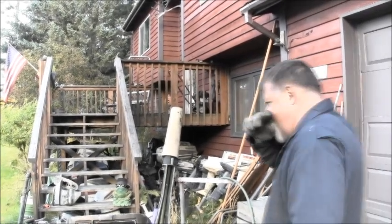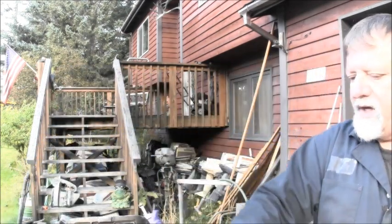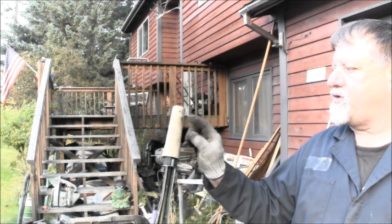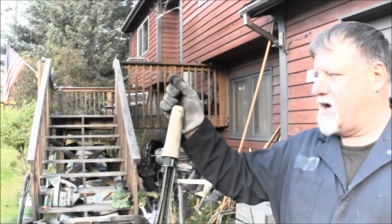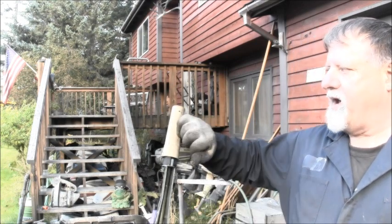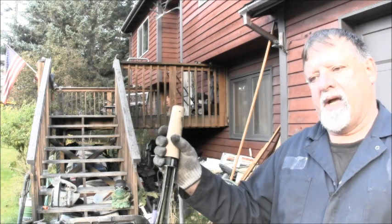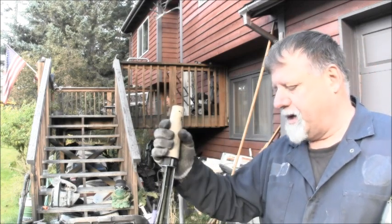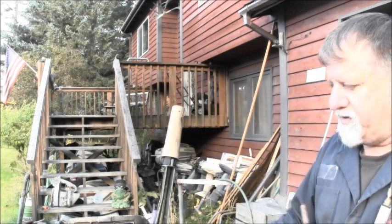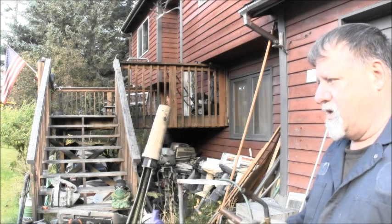Okay, here's your hack. You see this Phillips screw here? All this is just froze. All this rod going through, and they typically break them right at that screw. Now the rubber cover has already been taken off this. I have videos showing how to get them off. There's some slots right here that you have to cut with a knife in order to get that rubber cover off. And then you can just use contact cement, paint it up, and put it back on when all this is done. But that screw is a Phillips screw, and on these salty ones, you're not going to get that out with a screwdriver. So I'm going to show you how I do it.